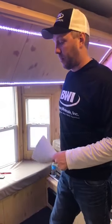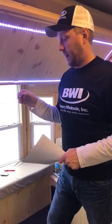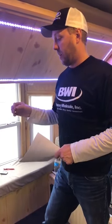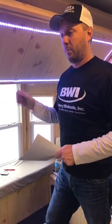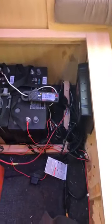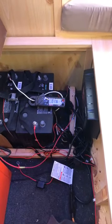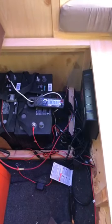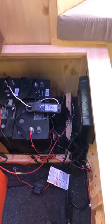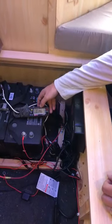I'm still trying to pinpoint what amp hour charger is on here. But what I'm going to do is walk outside quick and plug the house back into the wall, because right now we're showing 9.7 amp hour. I'm going to plug it in and see what it does the reverse way, if we're gaining more voltage or not. So give me just a second. Looking at the gauge here, it's actually pumping 16.9 or 15.3 amps into the battery right now, and it's working its way back down.